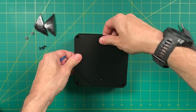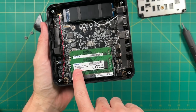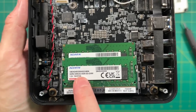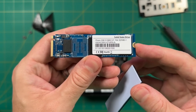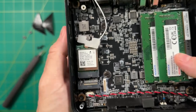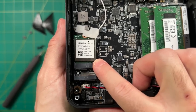While we're in here, let's take a look at the components. Starting with the RAM — you can see the brand name right here. There are two sockets, and the RAM that came with it is DDR4 at 3200MHz. We also have a FISON M.2 2280 drive — 512 gigs. And underneath that drive, there's an M.2 Wi-Fi chip, a very common chip rated for Wi-Fi 6E and Bluetooth 5.0.